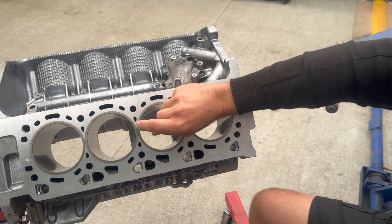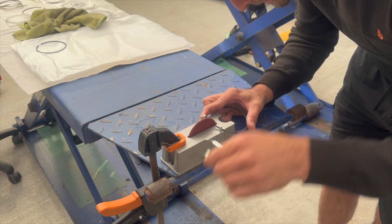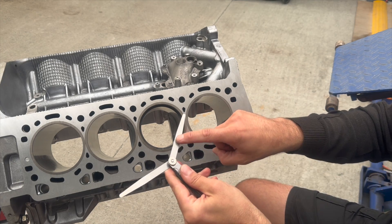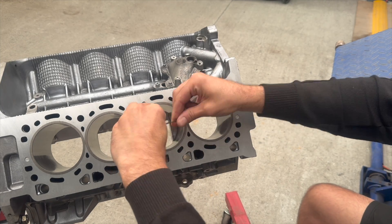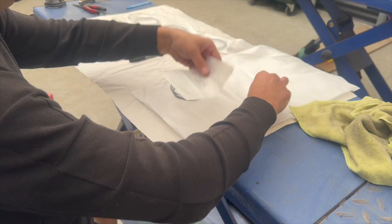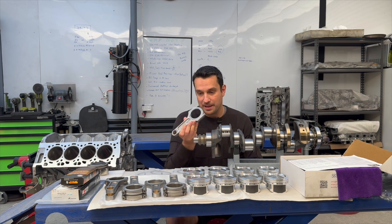Now that I know the gap size, I carefully remove the ring from the cylinder and take it to a piston ring grinding wheel, where I gently grind down one side of the ring to increase the gap between the two ends. Then I take it back to the cylinder and measure again. You repeat this process until you achieve the desired end gap, but you have to be very careful — if you grind too much there's no going back. If the end gap is too wide that could be an issue. Repeat the process for all cylinders, individually pack them identifying the cylinder number, and you're ready to move on.